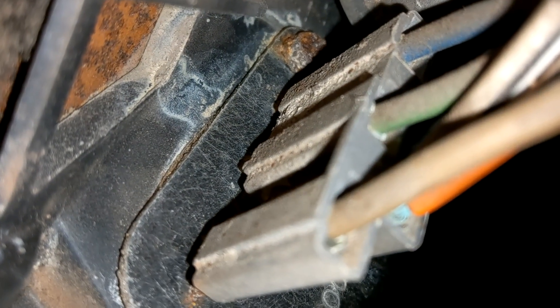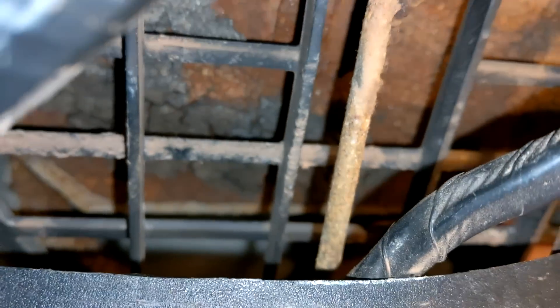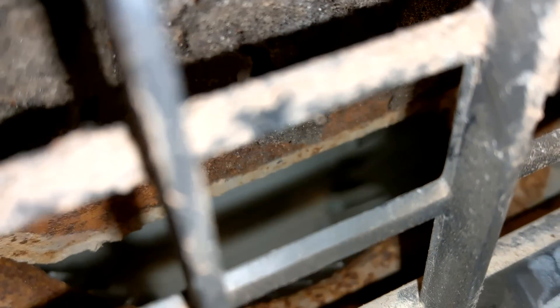For the older models they are pretty similar. If you take this cover off - it's got Phillips head screws - and slide back here, that wire connector right there is what I believe to be the blower motor resistor. You can see we've got a bolt there and a bolt there. We can pull that and make sure the resistor isn't blown out. If you open up this flap you can actually see the wheel in the back - the squirrel cage. The motor's probably seized.